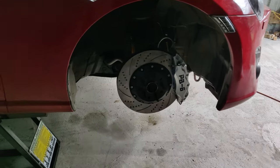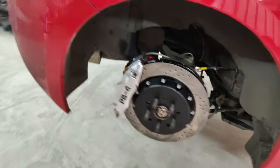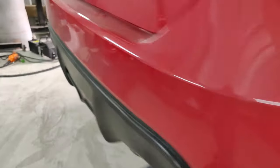in a future episode. We were able to get the handbrake all sorted on both sides, tested that, and that works. Got all the rear brakes installed, got them all shimmed up and spaced out exactly where they need to be, and then got the whole system nice and bled, so we get a nice firm pedal feel back. So I think that's it, finally, on the brakes. I think they look pretty good. Coming around to the other side.